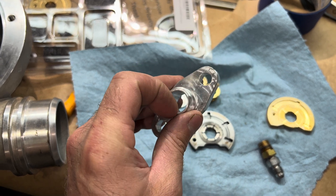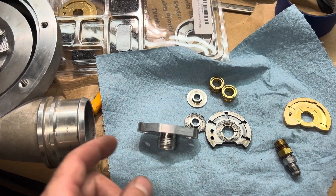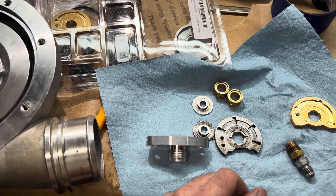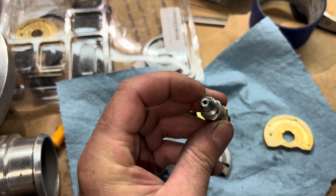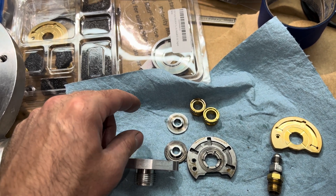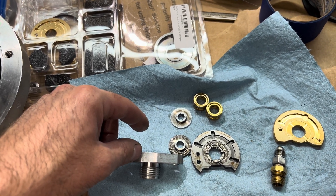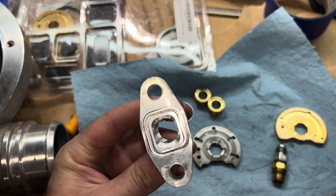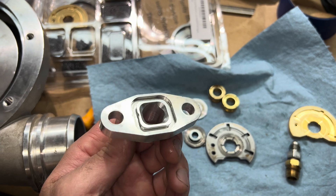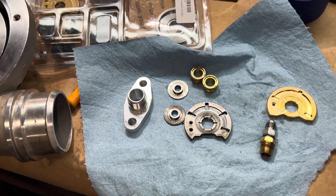What happens is when you use something less than half an inch for the drain, oil starts to build back up into the cartridge and can't escape. Once it builds up in the cartridge it goes out both seals — the front and the rear of the turbo. Then people read on the internet that you need a restrictor, so they restrict the oil feed going to the turbo and the leaking stops — however, now you have less oil, less cooling, the turbo overheats, and it needs to be rebuilt soon after. So just go ahead and drill or machine out that drain. I've got the perfect setup to machine these and I can do it for people who send in turbos for rebuilds — it's not that hard.